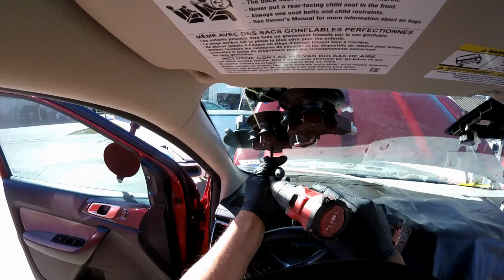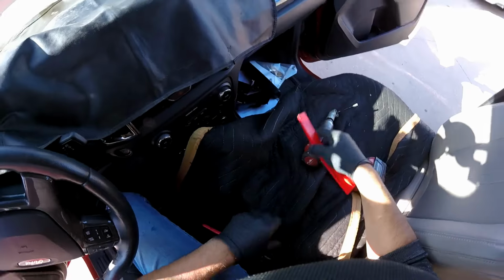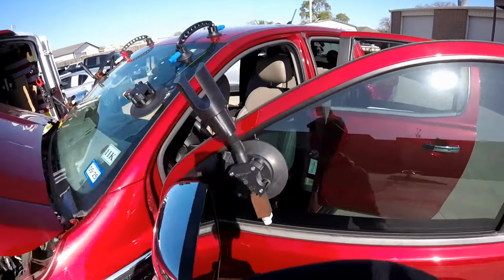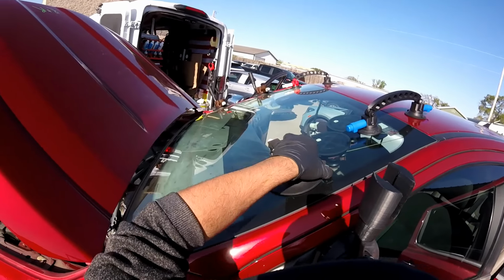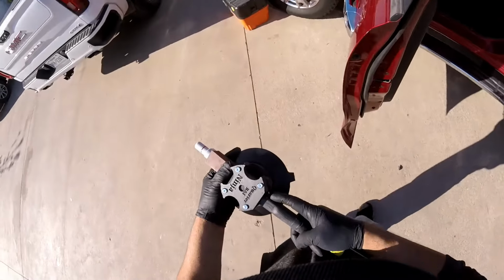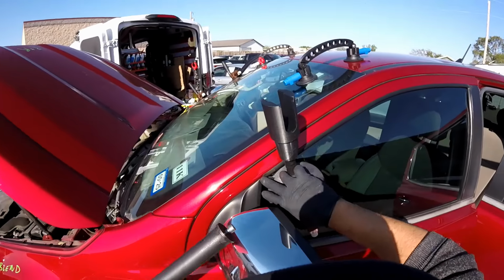Okay. Right there, okay, and that's all. So the glass is not falling down because we got the arc clamps on the top. And right there. So as soon as I take the back glass, I'm gonna set my setting tool over here. Let me see where's that. Oh, right here. So the same way, and this suction cup works with the same WRD system, so you can use it over there, over here. Okay. Remember, we're taking this one.